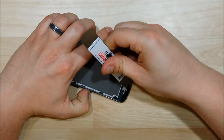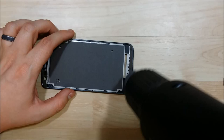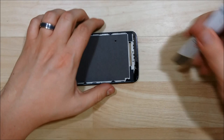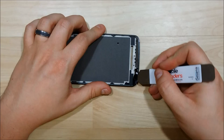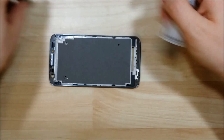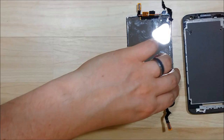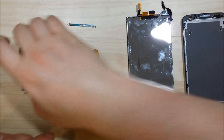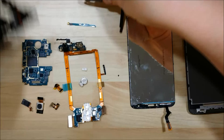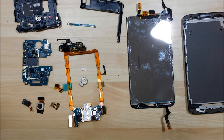We're going to clean up the mid-body of this phone and get the rest of the glass off. Make sure if you're going to reuse the mid-body that you clean up all the glass and glue around the side so it has a nice flat surface. If you need to use a little additional heat to get the glass and glue off, feel free, but don't heat it up too much or you'll melt the plastic interior frame. This phone is now completely disassembled. If you have questions, feel free to post them in the comments. The reassembly video is linked at the bottom — go ahead and click it to watch me fully reassemble this LG G2. I plan on doing a lot more videos including an LG L9, a Galaxy S3, a couple of iPod Touches, and an iPhone 4. Subscribe if you have any of those devices you need fixed. Thank you.